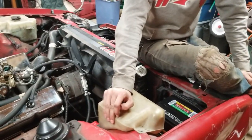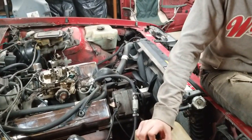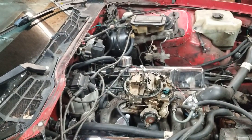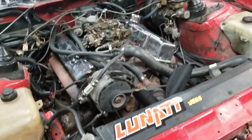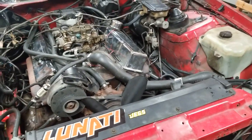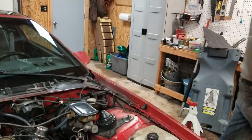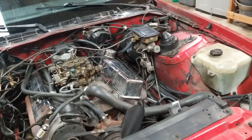The game plan here is to put the jack underneath the balancer. We're going to jack the car up first and probably put it on the ramps over there. Then, once it's jacked up, undo the motor mounts down here and jack the motor up. We're going to take the distributor out. I think we'll need to get the motor about four inches off the frame. If everything goes as planned, we'll be back with the car up on the ramps and the engine about four or five inches off the K-frame.